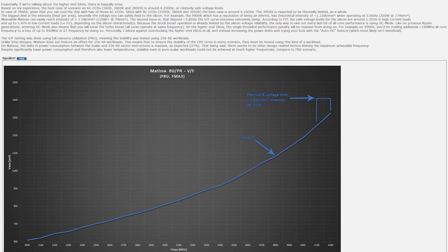What was happening was it didn't matter which chiplet that boosted core was on — at any given time it was most likely being used, so I was getting a higher single-threaded performance boost. Even though it was only on one or two cores, that made a big enough difference in those titles to retain some performance. That's why in 3DMark I was losing performance — my single-thread was going down by as much as 450 MHz on the single core overall. So even though all the cores were running higher, in actual real-life gaming applications that rely more on single-threaded performance, I was losing a little FPS because I was losing that core boost.